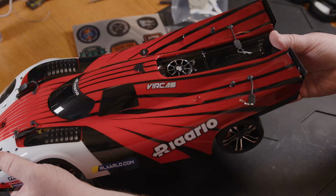So you've got a normal receiver type plug on both of them that should just go on to positive and negative. And then it also looks like, let's get rid of these zip ties. So it looks like we've got a whole bunch of wiring coming from the rear as well. So if you do have a light controller, you can wire all these up independently. So it looks like we'd have one for turbo flash, one possibly for brake lights, and then one for each indicator. So yeah, the roller does come with the turbo lights and the brake lights and indicators.